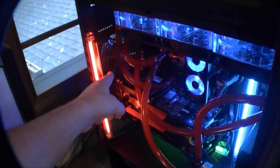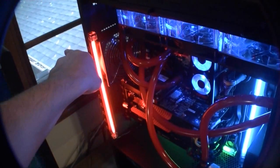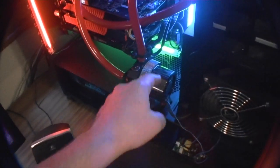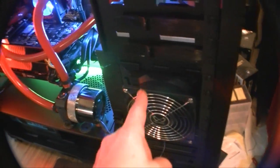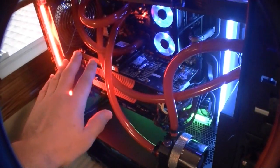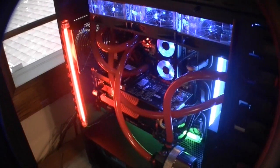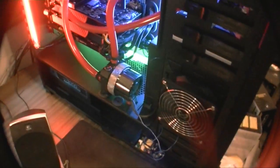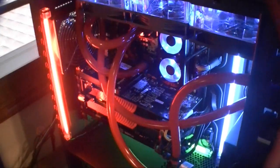The fans that come with this case aren't great. This fan was originally an exhaust — flip it around and put a powerful fan in there as an intake. Make sure you have a powerful one at the bottom as intake and one blowing in on the side, otherwise everything just suffocates. There's a guy who does 'Time to Live Customs' who did a five-part series on this case that really helped. I'm getting temperatures in the 40s — even the cards are in the 40s, which is better than my Antec case.